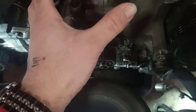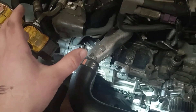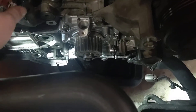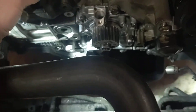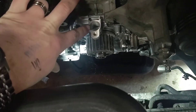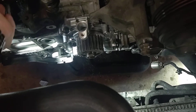To make this install easier, I've removed the alternator and the power steering pump — there are plenty of other videos on how to get those out, they're pretty straightforward. One of the main things to disconnect when doing this is the crank position sensor right here. It's held in with a 10 millimeter bolt, and I just tuck it out of the way.